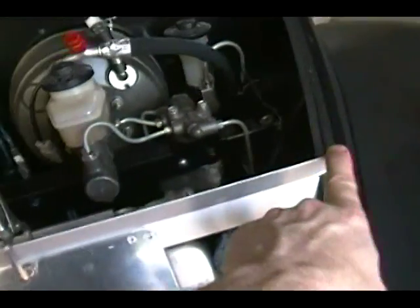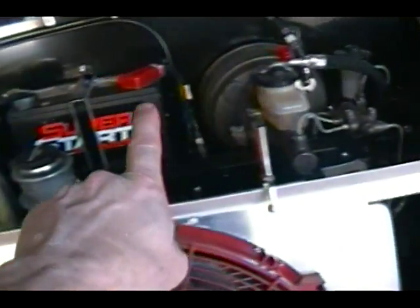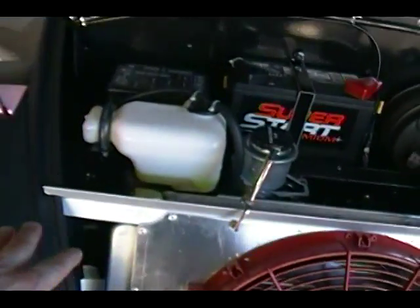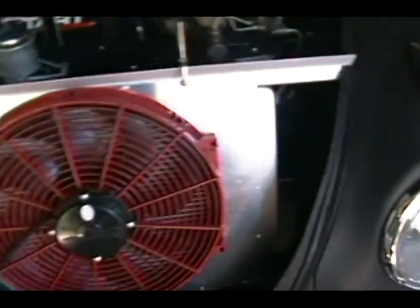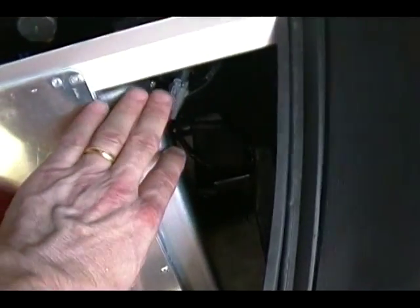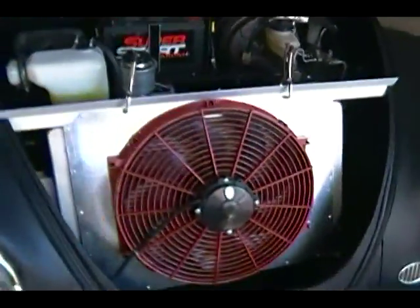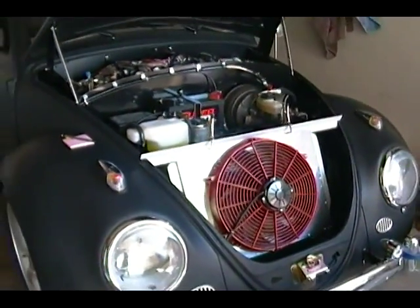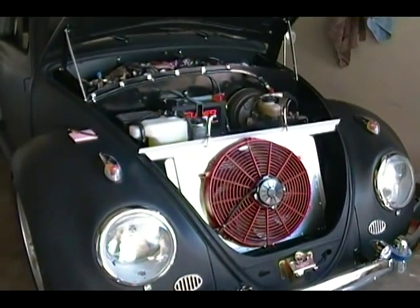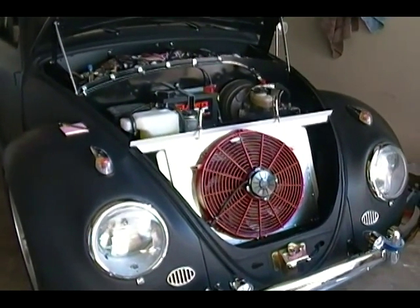Then I'm going to build that panel from here — it'll come up at an angle, and I'm going to put a piece of rubber bulb sealant on the top of it. When that's done, I'm going to build little aluminum panels that close this off on this side and close it off on this side, so that I can separate the nose — the complete nose of the car — from the back of the foot box. As soon as I get this mounted on here and the hood can close, I'm going to get the top piece made.